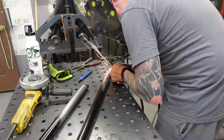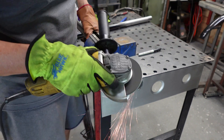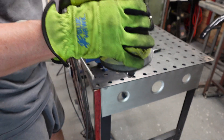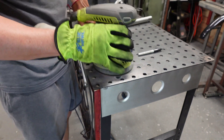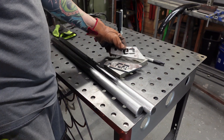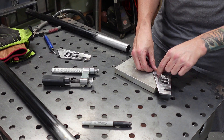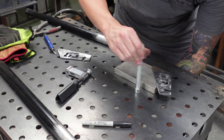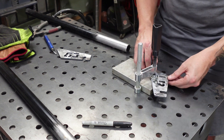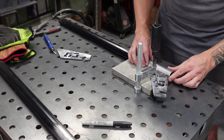Yes, I know in the comments — yes, I am tack welding these in 16-gauge steel. It doesn't need to get super burned through, but I do love cleaning it up. I like to make sure that I do a lot of good metal finishing. The reason I'm using a DA with some 80-grit on there is to clean the metal up real nice — makes everything look professional. And these right here are my own extended drops. They do really well if you're running a 29-inch front wheel or you want to poke that front end out a little bit. This aluminum block here is what's going to hold everything down — it's about a half inch thick and it allows me to put my fork right up against it, and it's the perfect distance that I need when I put the front wheel on.